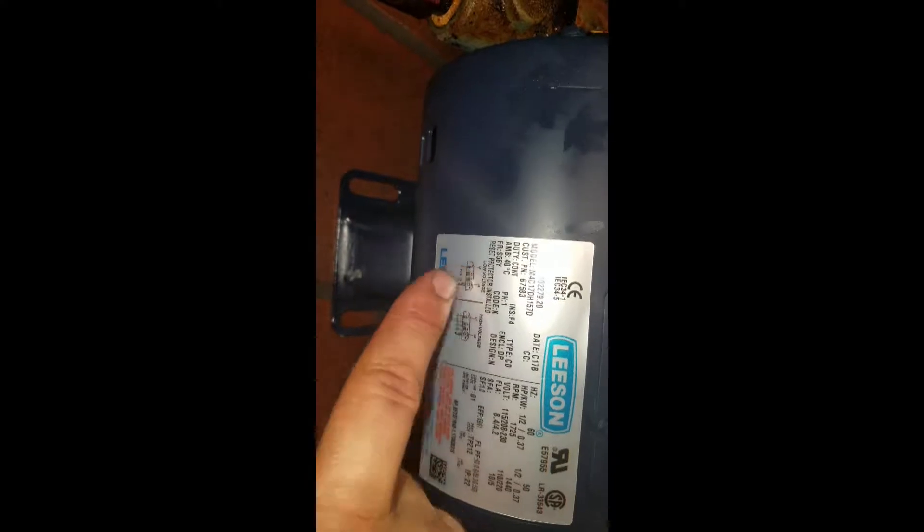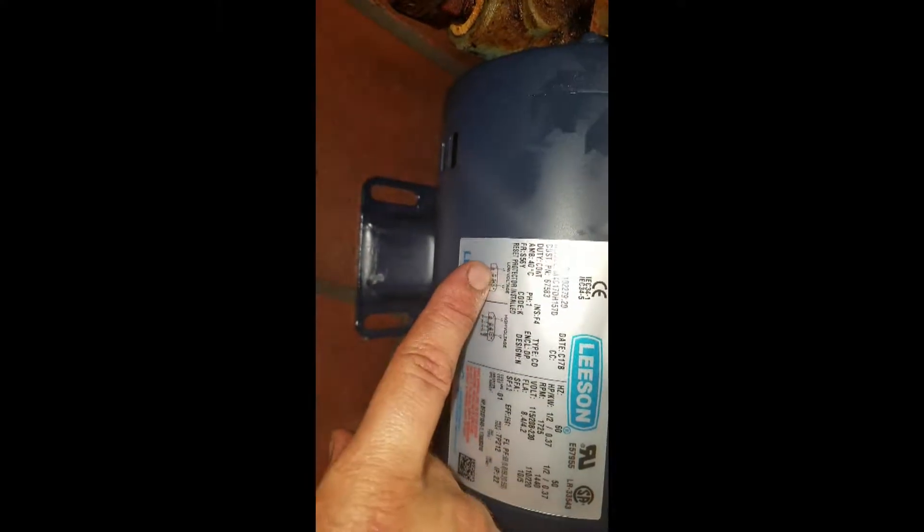This is part number 17446 for the rollers. Now make sure this is wired up correctly — for this particular fryer, it's a gas fryer so it's going to be wired up for low voltage. You can see it's got two possible voltage types: low voltage and high voltage, meaning 120 and 208. We've got to wire it up for 120.